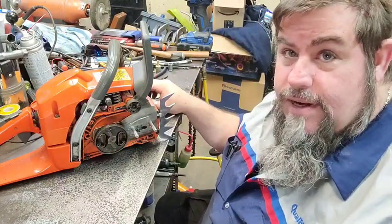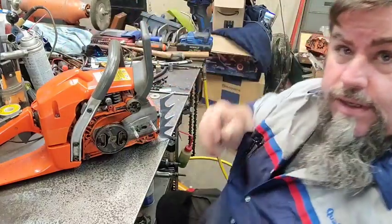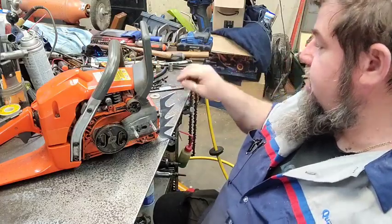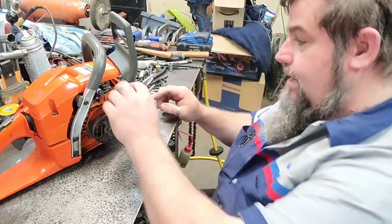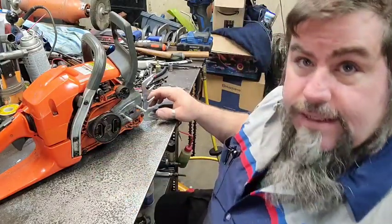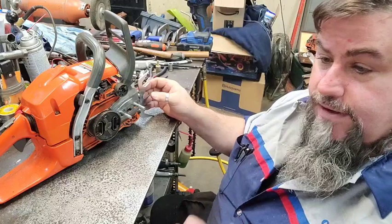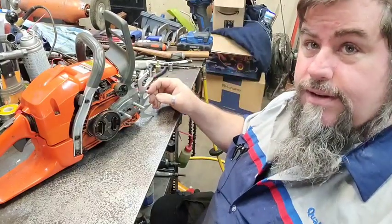I have taken some before and just took the one that fits it, cut some of it off, and just welded another dog on it. It all depends on what you want. I'd say that right there is gonna suit me just fine — I'm probably gonna run a 16 or 18 inch bar on this saw, probably 3/8 LP, just for fun. Just remember this is for fun, so don't get all excited. This is an easy way to get a dog on there. You can lay that dog on another piece of metal, trace it out, and cut you out a dog — all kinds of stuff.